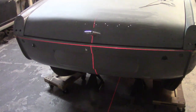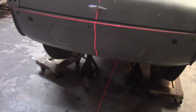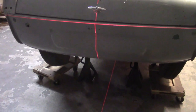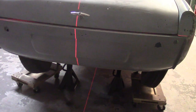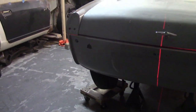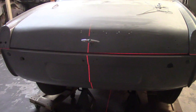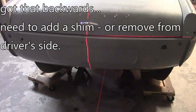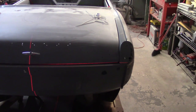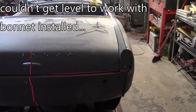Going around back - this level line is really close, actually so close it might not have been worth messing with. Going up to the line of the boot lid, it's just barely touching the boot lid over there and just barely touching the bottom of the turn signal over here. That tells me the body is a little bit crooked - just a little bit. The way it's leaning tells me I need to pull a shim out on the passenger side to drop it down a little bit.